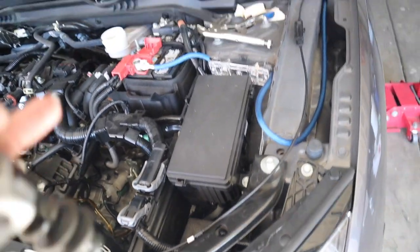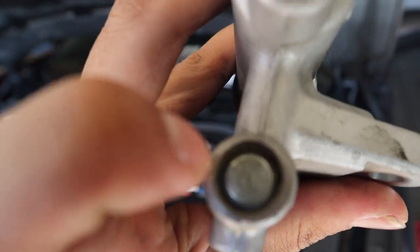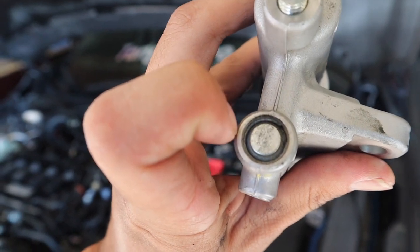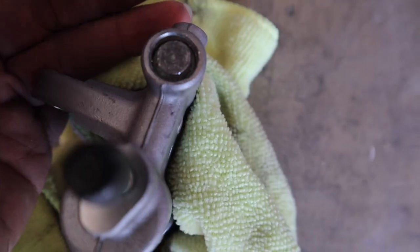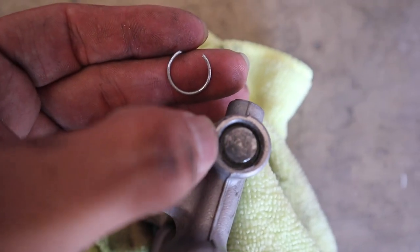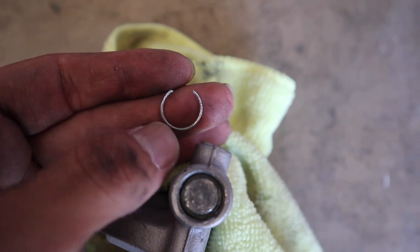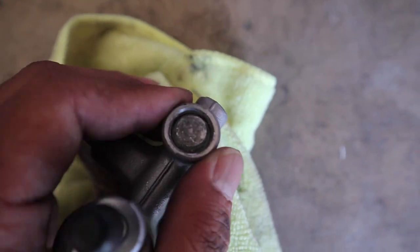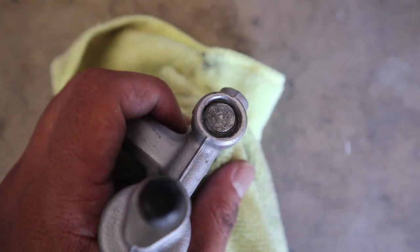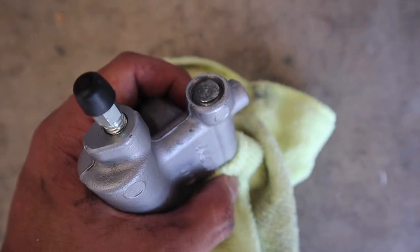Now we focus on the clutch slave delete. If you look right here, there's a little clip right there on the edge — you're going to need to pry that C-clip out. And once you pry that out, you're going to pull this middle one completely out, and then you'll have a tube inside. So here's that clip I was talking about — it literally sits right here on the inside. I just hammered down the middle part a little bit with the socket that fits between it. And then with the picking tool, you just got to get this clip out. At this point, you just grab a needle nose and pull that middle part out — that's where your clutch delay valve is going to be.